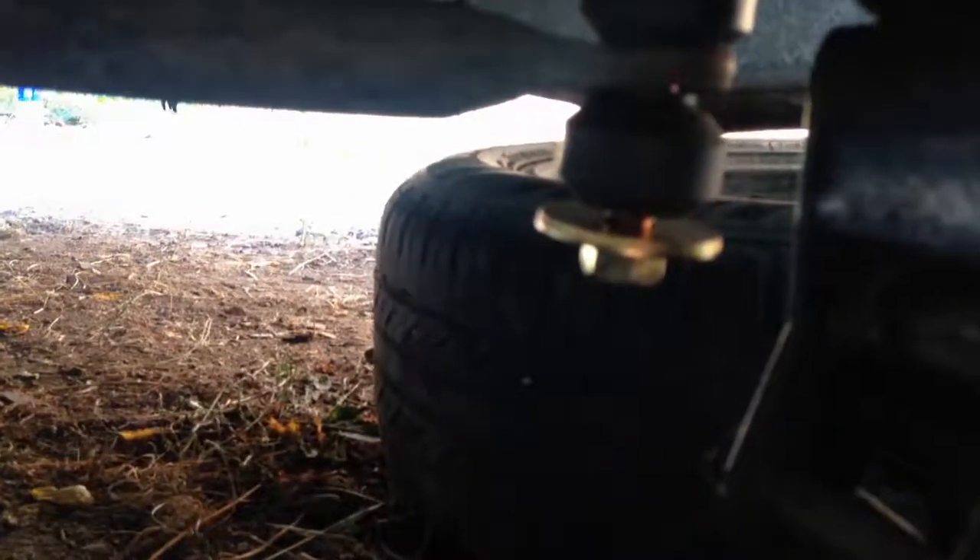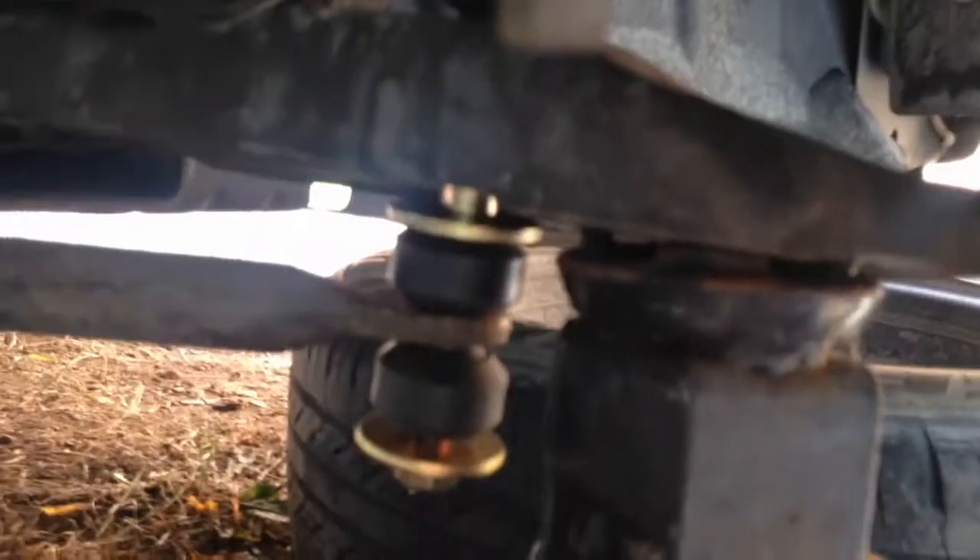Just like that — you beat it in there. It scarred it up a little bit, but not bad. You just push it down from the top once you have a gap. Let the jack down a little bit right here under the A-arm and that brings it closer. Then put some blue Loctite on there — whatever kind you want.